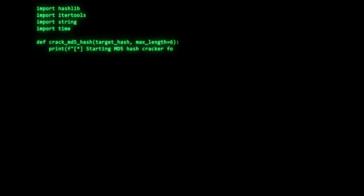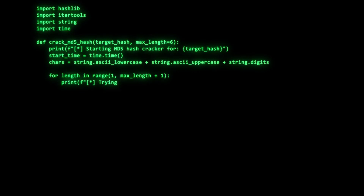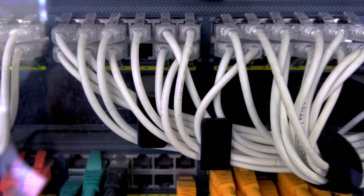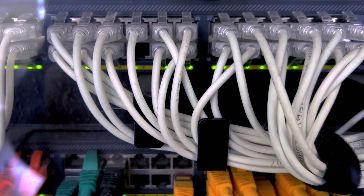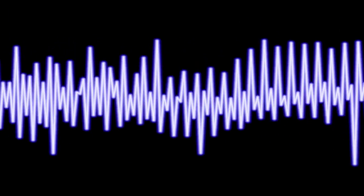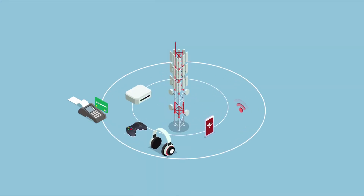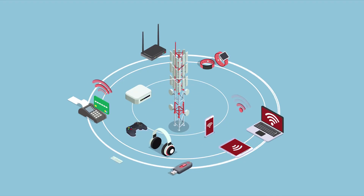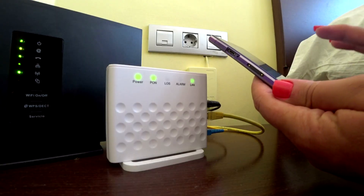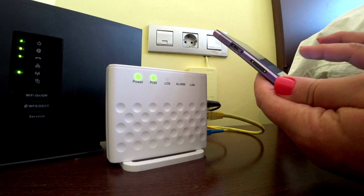Now you might ask, why is my Wi-Fi slower than my wired connection? Wired Ethernet ports on the router connect your device directly to the switch inside the router — minimal interference, maximum speed. Wireless connections face radio interference, signal attenuation, and shared bandwidth. Also, if too many devices are using the router's Wi-Fi, the internal processor and RF modules may become bottlenecks. That's one reason why investing in a better router can help if you have many streaming or gaming devices.